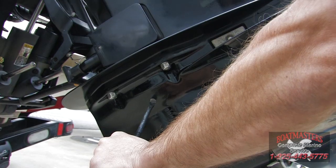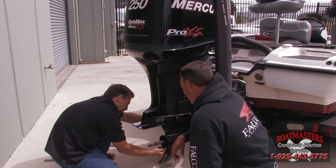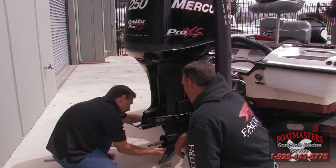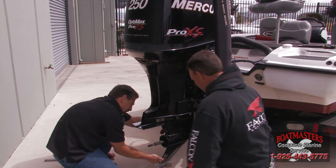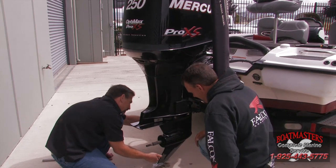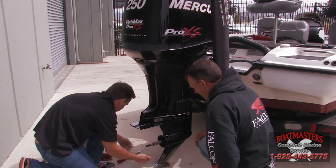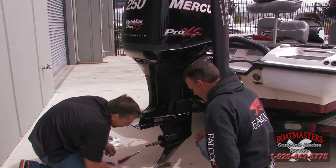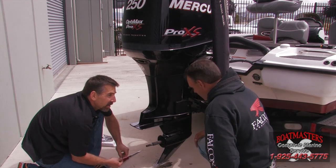And that side vent is going to let a little air in there and let water out of my outdrive? And we got water in there. Okay. So I've got a problem. Here, we're going to show everybody at home what a problem looks like. And that's not good. Nice. So you just prevented a gear case from failing by checking your gear oil. Because if you would have continued to run it with water, obviously water's not a good lubricant, and it will destroy the gears. Well, I'm glad you checked it.